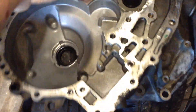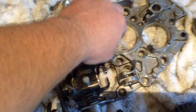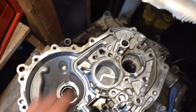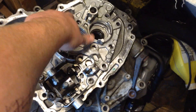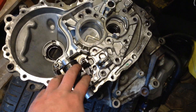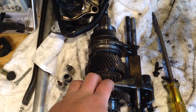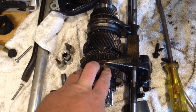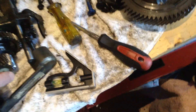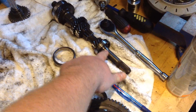So that's where the differential sits. And then this is the bell housing — this mates to the engine. So the diff sat in there, and this plate here sits in there like that. It needs a bit of persuasion because there's some guide collets. Then your gear towers sit in there. So that is your lay shaft — I think it's a lay shaft, correct me if I'm wrong. That is your drive shaft, that comes from your engine, and your clutch goes on there.